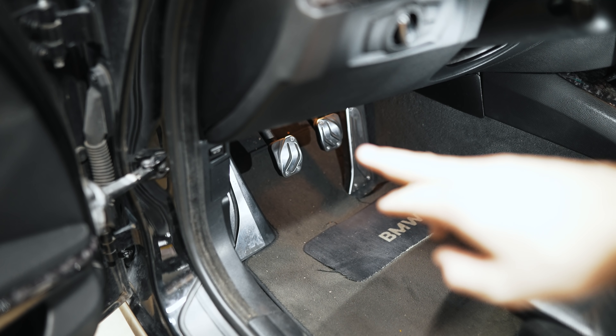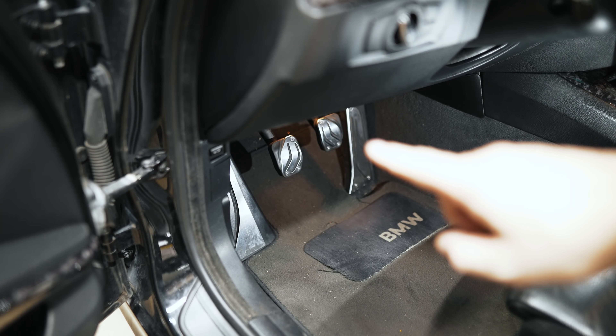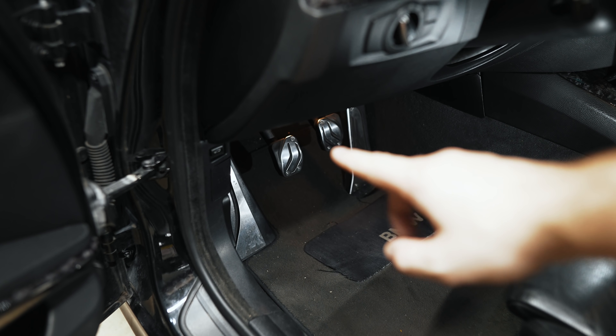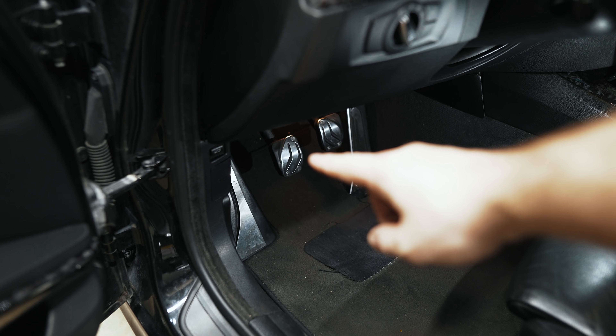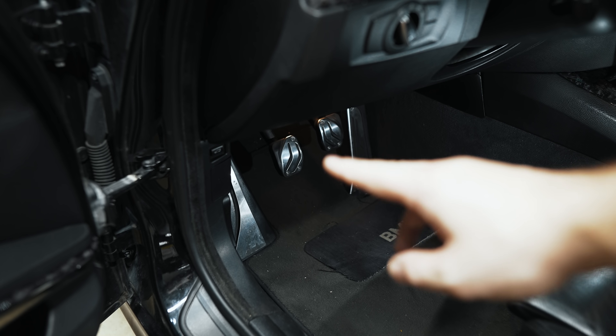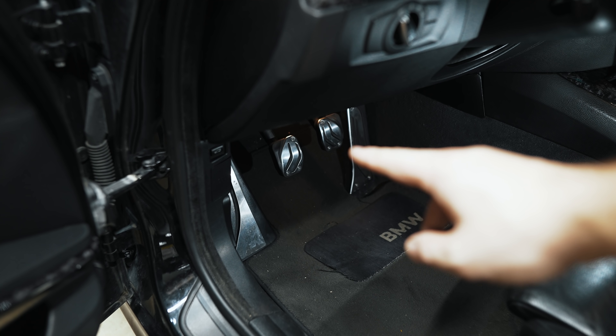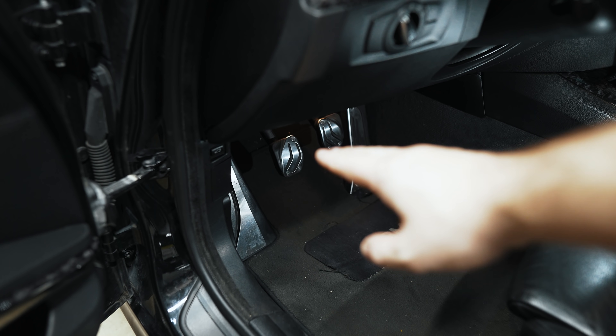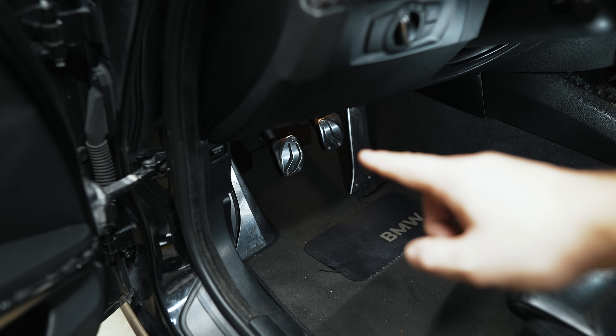Here's a scenario you've probably experienced: if you've braked about three times in a row over 100 miles an hour without letting it cool down for multiple minutes in between, when you go to press the brake pedal it sinks down further than you're used to and you don't get a reassuring feeling. In terms of having good bite with heat in the rotor, that would require better pads and drilled or slotted rotors, but in terms of avoiding a spongy pedal, that can be fixed with what we're going to do in this video today.